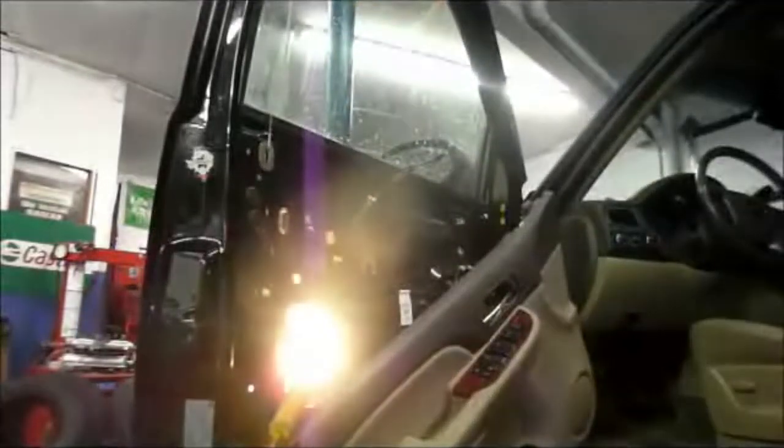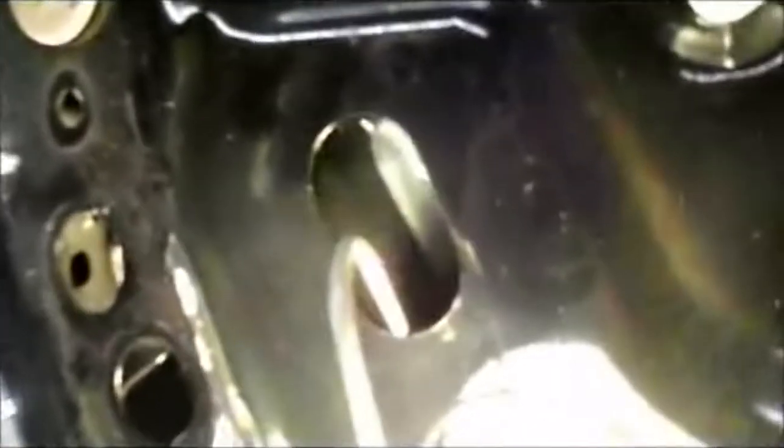Let me show you what actually broke inside the door. We're going to need to replace the latch itself because it snapped off. This is the piece here that broke off — on the interior of the outside door handle. You can see that piece moving right inside there. The end of it snapped right off to the left — you can see it snapped off. I'm going to point it out with a screwdriver: see this piece right here? That's what snapped off from inside.